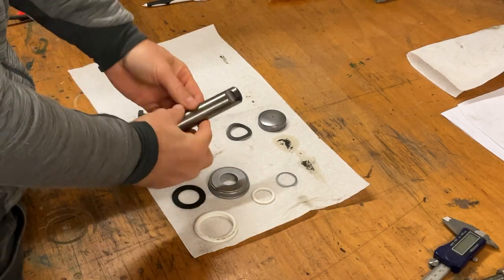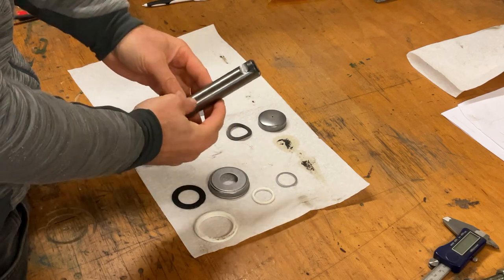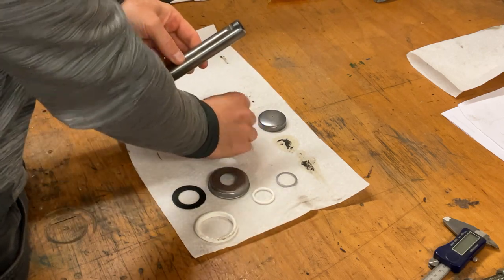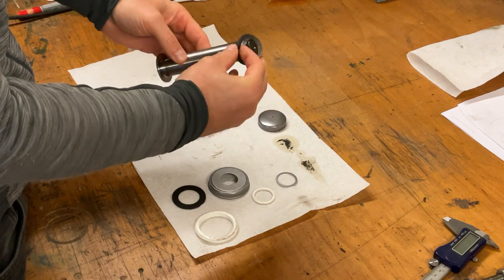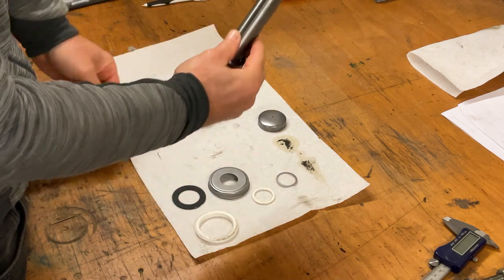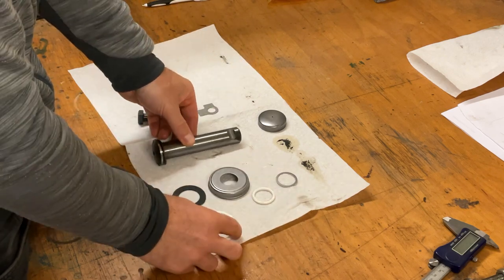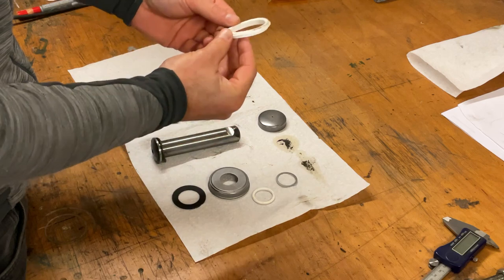After all that, it's time to reassemble the steering system. All the pieces I built back in are new, starting off with the shaft, with a spring washer going through the housing, through the bushing. Of course, we also lubricate it with some grease.